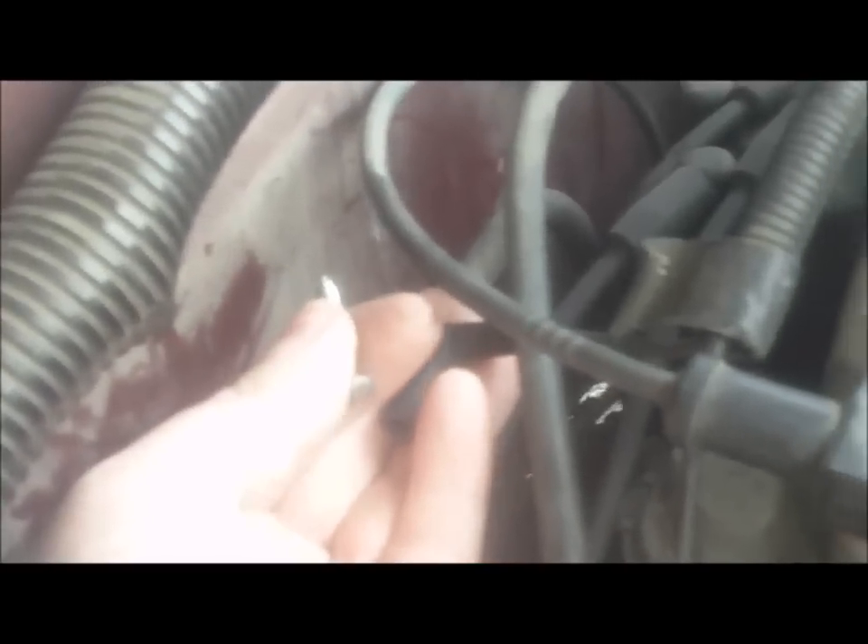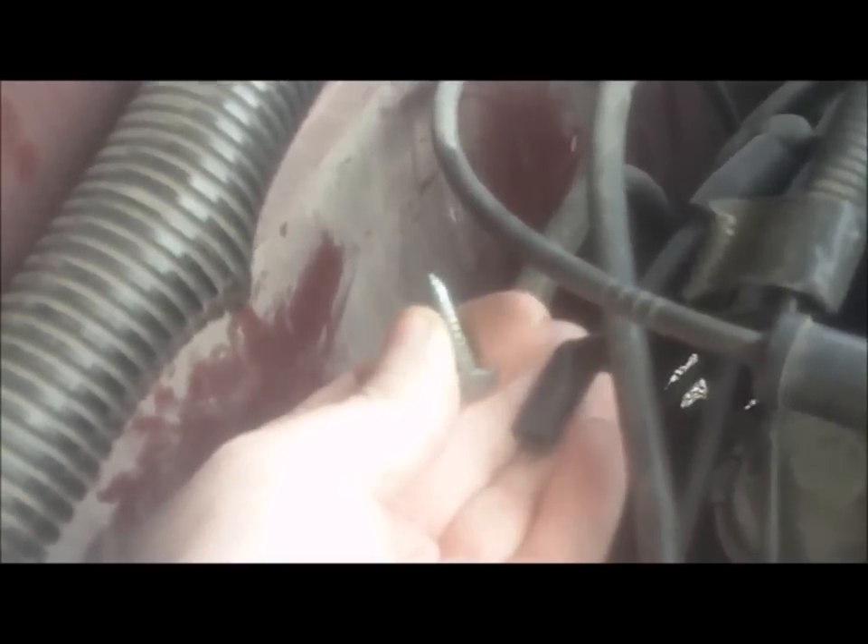There it goes — snapped the plug in, so it's wired. The last person that did this just had a screw plugged in there, which is not good. This one down here goes to the EGR; it's just a little coupler. I'm going to replace this — it's a bit loose anyway. That's how they fixed it, they just capped it off and plugged it up. I'm just going to cut off a little four-inch section.